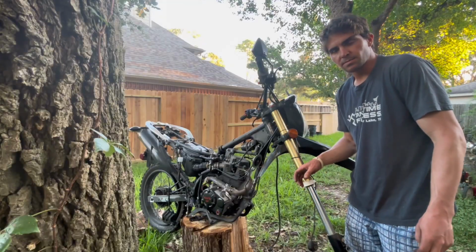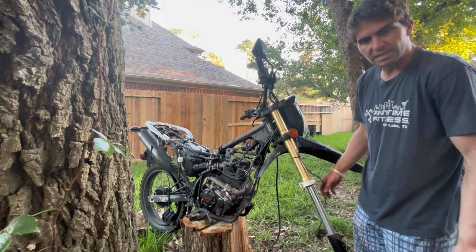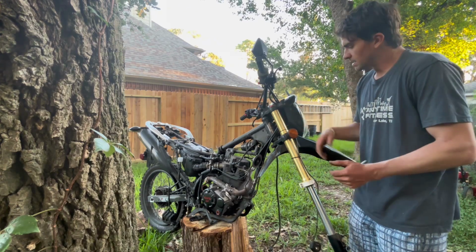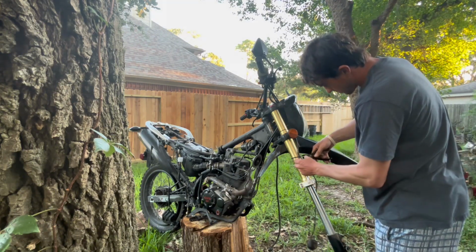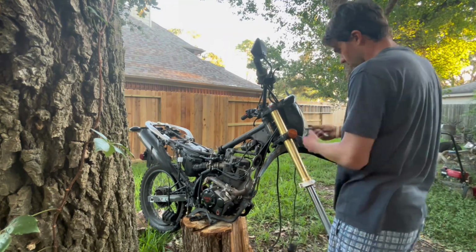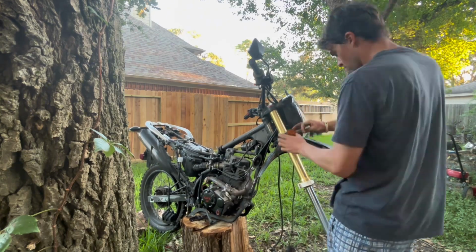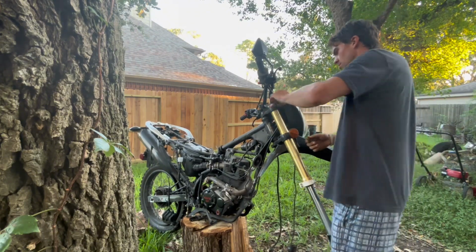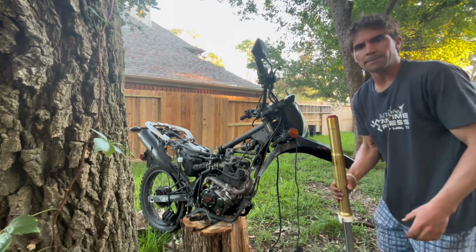So moving over to the right side of the bike here, we just have a couple zip ties holding in our speed sensor, and then we're going to repeat the same process. So you got a couple bolts here, a bolt up here, they're both 10 millimeter. Zing them off, fork will fall. First, let's cut these zip ties. Like butter.